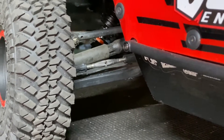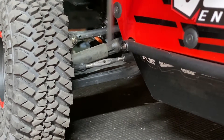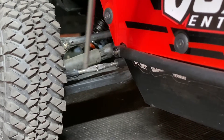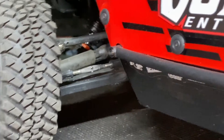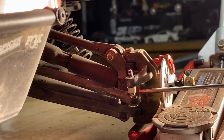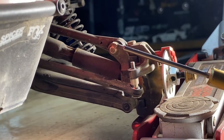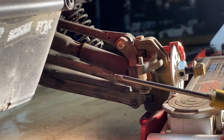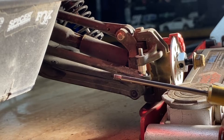That's what we call bump steer and it has to do with this rear-ward link geometry. Your toe link and your camber link - if they're not running on the same plane, even from this angle it's hard to explain without drawing a diagram, but that creates a lot of the bump steer we're seeing. Going back over to my truck, you can see this spacer I've added here has corrected that angle - these two links are now pointed on the same plane, very very close. That's 90% of what's causing the bump steer scenario in the front end geometry.